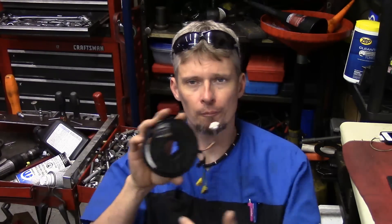Back in the day, about the only connection you ever had to have in the steering wheel was for your horn — just a single circuit. Once they started introducing airbags, it started getting a little more complicated. We started having anywhere from two to four wires for an airbag, and then we also had to have more convenience items — steering wheel controls for our radios, some have cruise controls, and of course the horn is integrated into it now. So you went from one wire to a combination of possibly ten or more sometimes. There has to be a connection from the bottom of the column up and also to everything in the steering wheel. Keep in mind, everything in the steering wheel has the ability to rotate, so the connection between the stationary column and the rotating steering wheel has to be a mechanism.